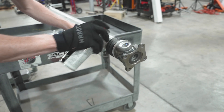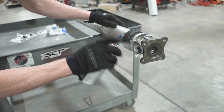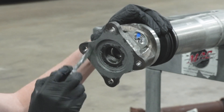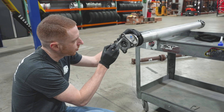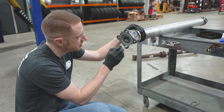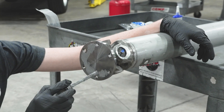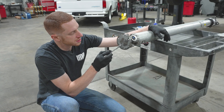Remember, you're painting flanges — not the body of a car — so you don't have to be perfect. Now we're going to take our anti-seize and put it in the main contact area. You don't have to go crazy with it. If you ever have to pull it off or sell the car, it makes life easier for the next guy. The anti-seize acts as a good barrier between the metals, prevents corrosion, and helps with disassembly.